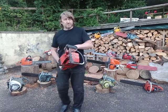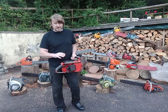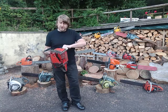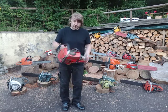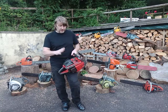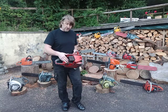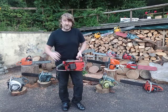So going up for sale as a spare saw, and the gentleman, I would have said he was extremely competent with the saws, and he said it has no spark and has been on his shelf for such a long time. He's just decided he wants to move this and a few other project saws, and so yep, I've bought those. So the ones I won't be working on, I should put up for sale exactly as they are. And sure enough, I've taken out the spark plug and no spark whatsoever. Put a known decent plug in it, no spark, and that's the extent of the testing.